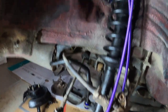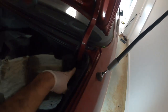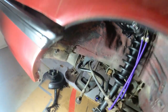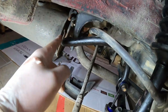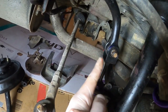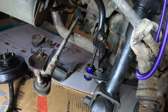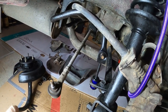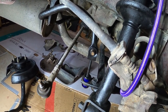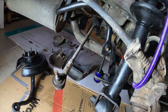Showing you the progress so far. Upper control arm installed properly through the holes, all the way to the back. Two bolts sorted out. Sway bar — there you go. I just need to put the cap and the actual bush for that. But it's installed. This is the end link, and these are the bushings installed properly. They're all painted and cleaned up as much as I can, but sadly you get scratches as you try to fit it in. Same side — the other side is pretty much the same process. It's a bit tedious. If you have someone to help you, that will be way much better, but it can definitely be done as a one-man job.